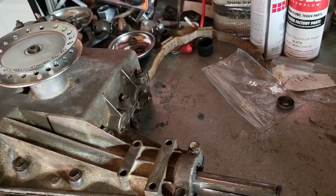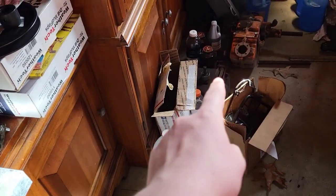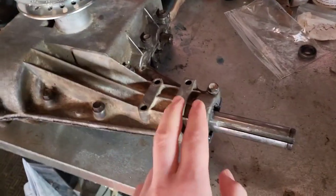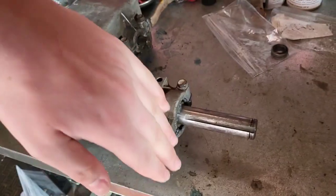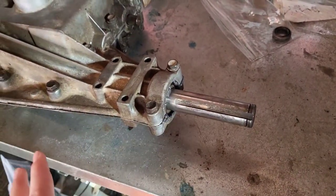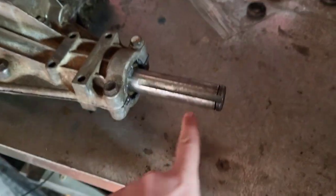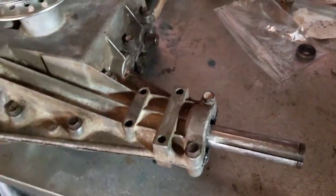I did a test — I set this one up at an angle and oil leaked out of that side. Before, I had re-turned to this one, set it up at an angle, and no oil came out. So to save yourself money on gear oil, lift this axle up and put silicone under there — save yourself in the long run.